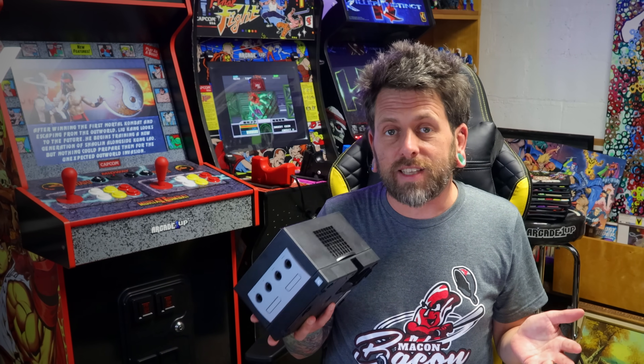We're going to make a weird W-type shape with this thing, and nest it between the motherboard's port connector and the port connector attached to the disk drive. What that's going to allow us to do is emulate the contents of the disk directly to the GameCube. It doesn't matter what region it is — this could be a Japanese one with a broken drive. As long as it powers on, the drive is what we're going to emulate, so you don't actually need that to work.